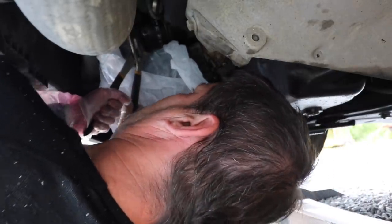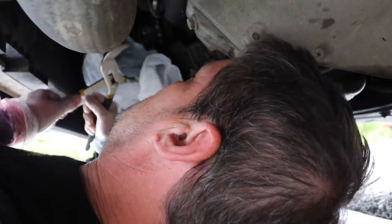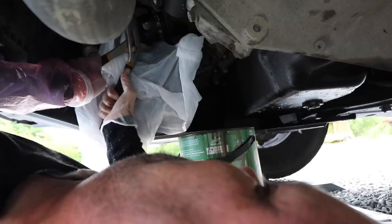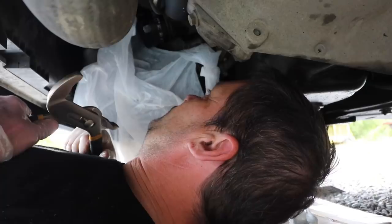It's not budging. Oh, it's moved just slightly — no oil coming out yet though. I think the grip's gone through one side of the filter now so it's had it. We can't drive anywhere until it's done. I've moved it half an inch but it's not far enough to loosen it. It ain't going anywhere. I'm going to have to hammer a screwdriver in and try it that way. I've destroyed it anyway — one end has pretty much gone through one side of it.